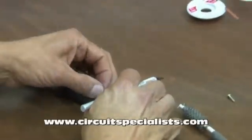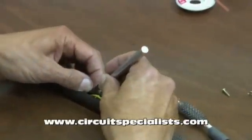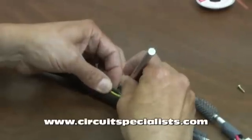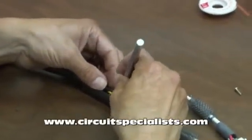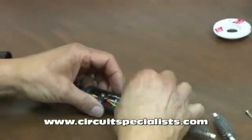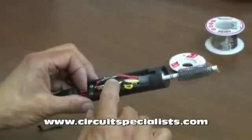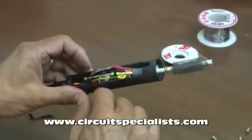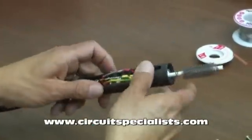This one came right out, but most of the time it's not going to come out that easy. The red wire connection came off pretty easily but the yellow one's not, and the reason is they put a very small amount of solder to hold them together to make sure the electrical connection does not get disconnected and also to allow for any expansion and contraction of these connections as the wand gets hot — because hot air is blowing through this entire assembly the whole time it's in operation. So for that I need my soldering iron to be able to remove these connections.